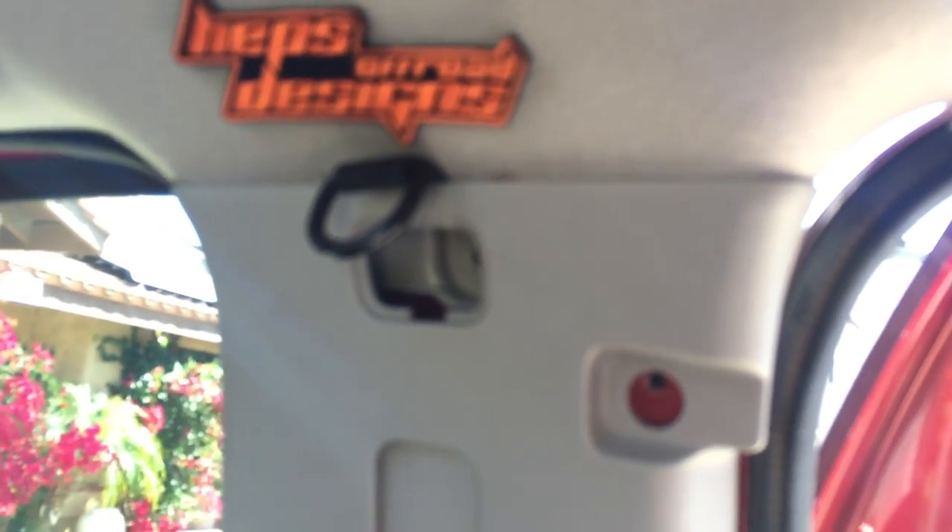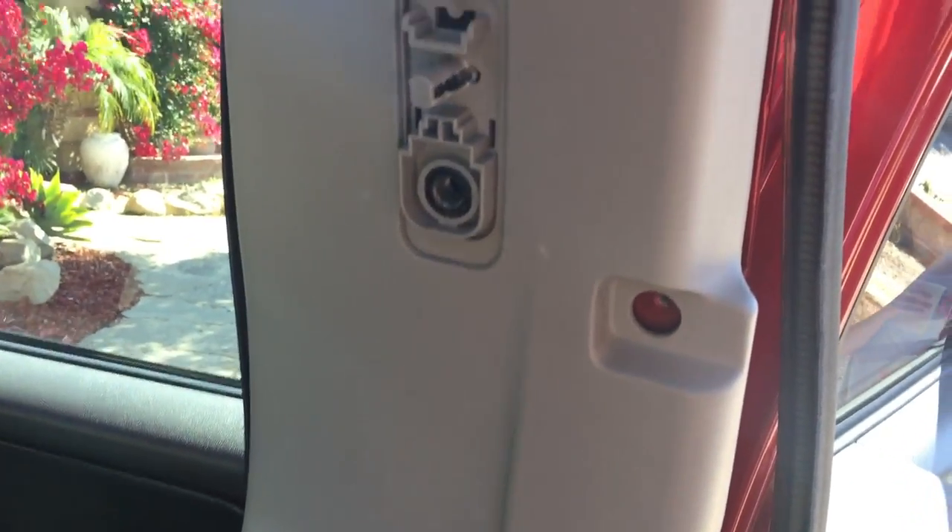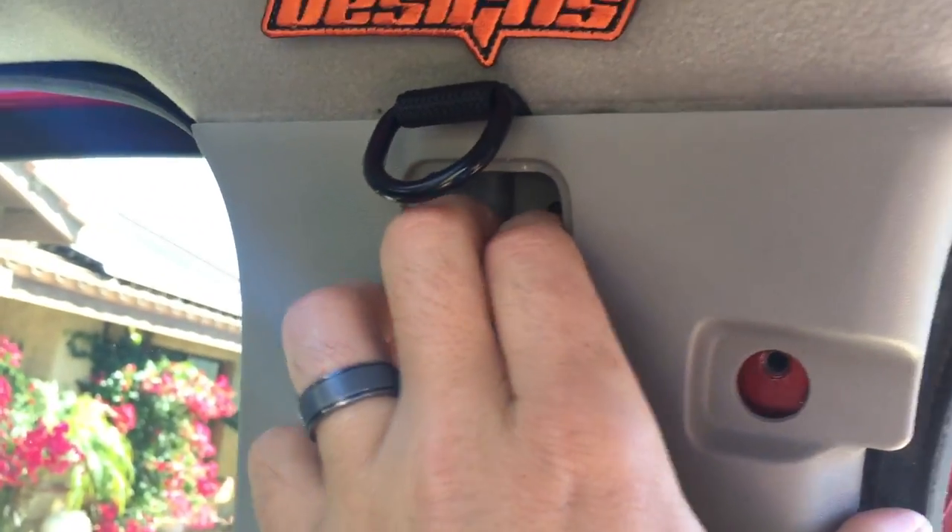There's a little 10 millimeter up in there, and that's what you're gonna do to get that out — you're gonna undo one of those little connection points. I'll show you outside. Over here I already started this side; as you can see I've kind of pulled all the clips out. I'll pull this off so you can kind of see what it looks like underneath.